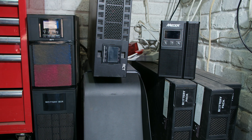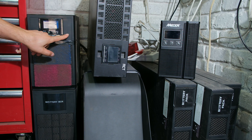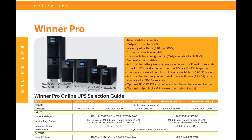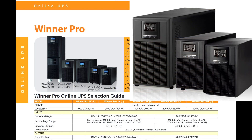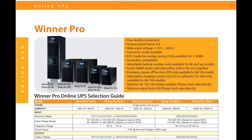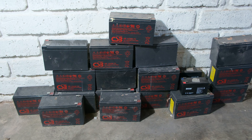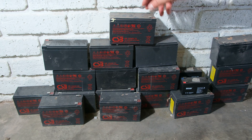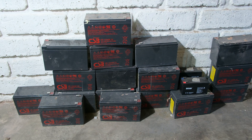Now let's talk about load shedding. Every UPS has to have a backup system, and this is where the problem comes in with all of these UPSs. They rely firstly on lead acid batteries which do not give a good lifespan. This particular type - regardless of branding, including the previous generation called Galleon - all suffer from the same problem: the batteries are connected in series inside. Here are examples of the batteries inside each UPS: they are 9 amp hour, specifically made for UPSs with wider terminals. I've replaced many batteries and they're not cheap, and notice how many there are per UPS.